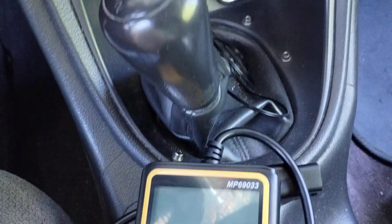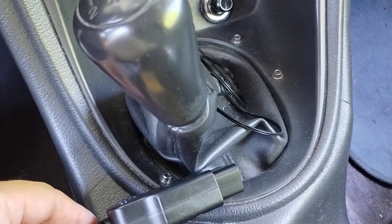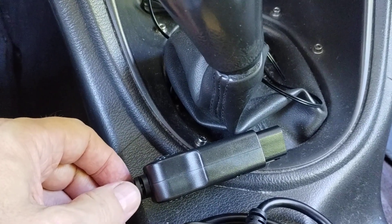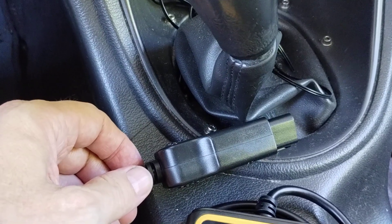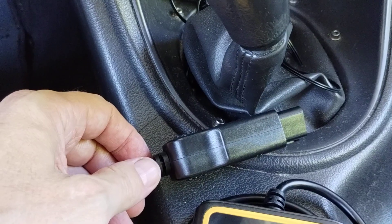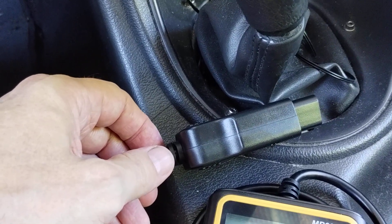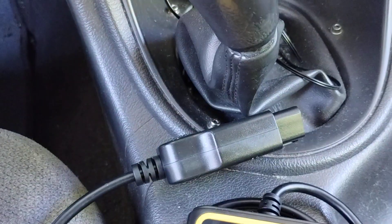So I'll show you where things are now. What I did was replace the PCV valve grommets on both sides — there's one on each valve cover — with the intention of handling any vacuum leaks. I also did a smoke test. There's another video on YouTube where you use a cigar and a fluid transfer pump. That worked great; I filled up the intake with smoke and no smoke leaked out visibly.